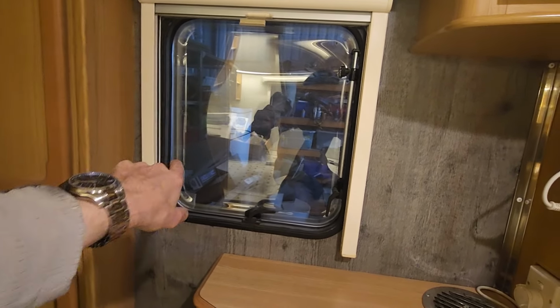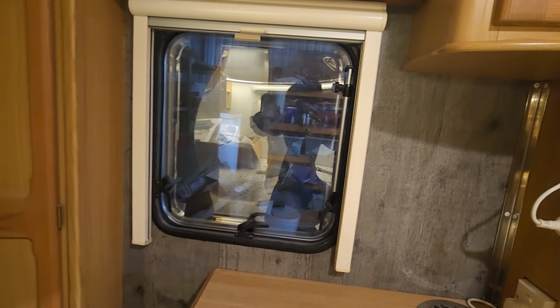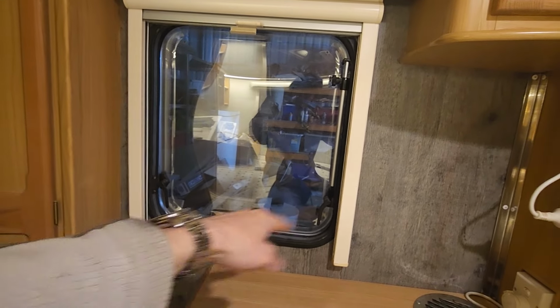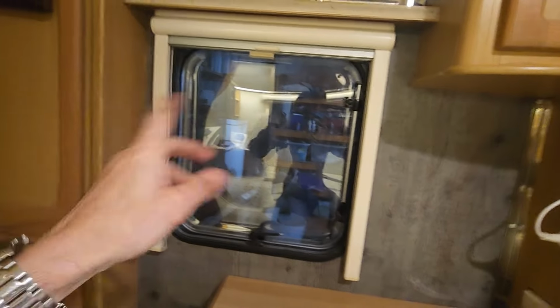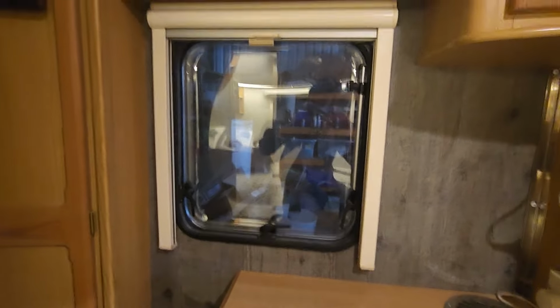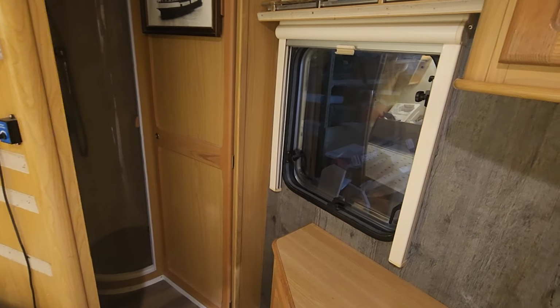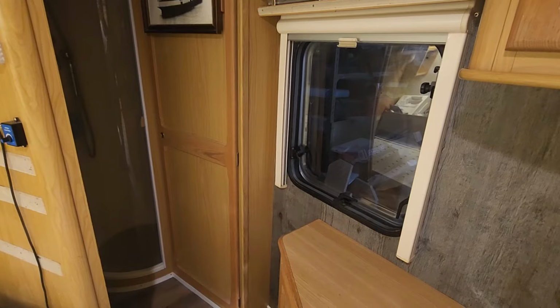These all have to be stapled, so sealant gets run along over the top of the silver top tar-back tape. You put sealant over the top, then the rubber seal goes in, then you staple it, and then you lay the inlay in. So not a straightforward job. Each one takes a while. And when your caravan has got 9 windows, like this one does, it really takes a while.